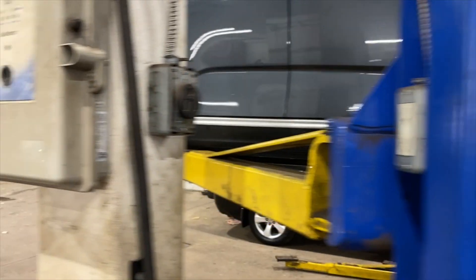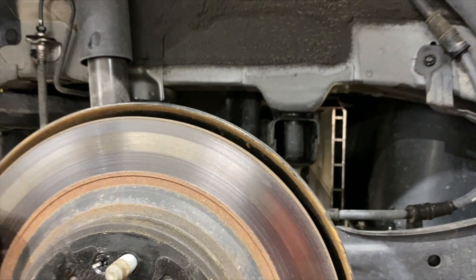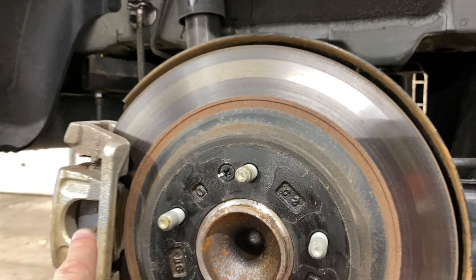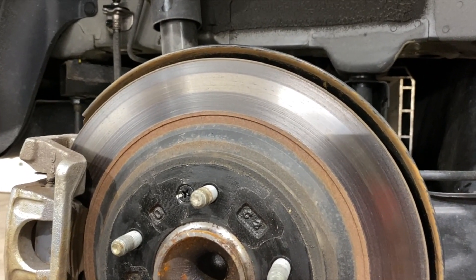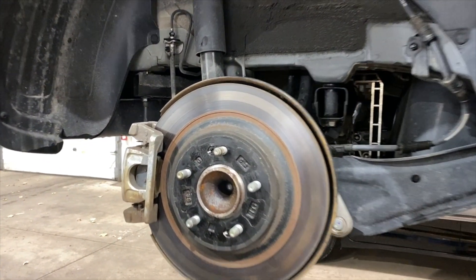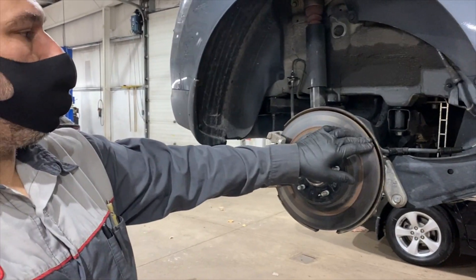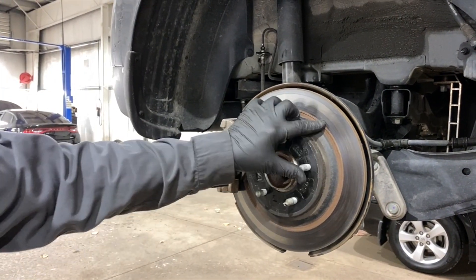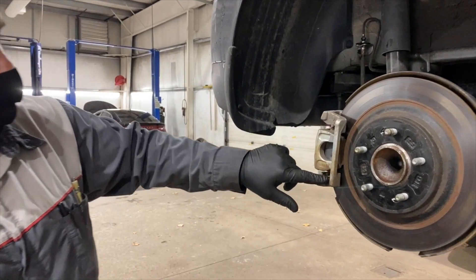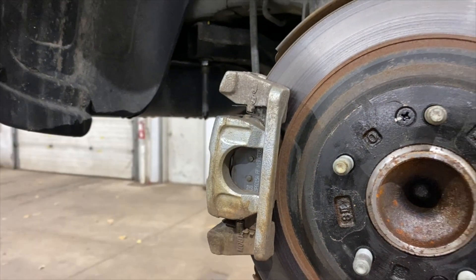The rear brakes look a little different — you can see a bit more rust and wear. That's because regenerative braking does not work on the rear wheels. To balance braking between front and rear, sometimes the rear wheel brakes are activated while the front brakes are not, since the front is doing regenerative braking. Chris, what are you seeing on these after 16,000 kilometers and one full year? There's no cross-hatching; there's a small rust ridge starting on the edge, and some rust starting at the brake caliper carrier contact points — those points would have to be lubricated in service.